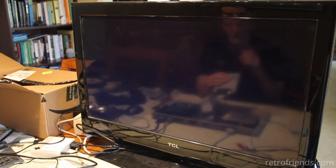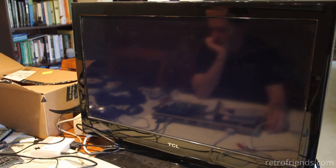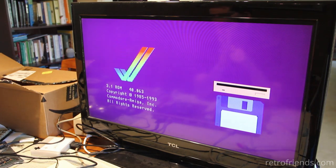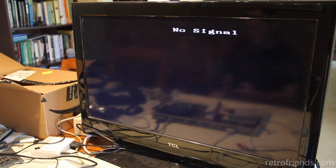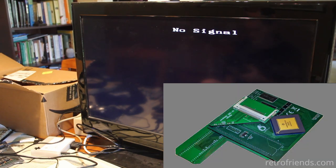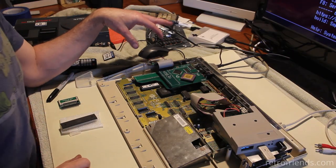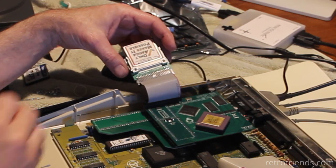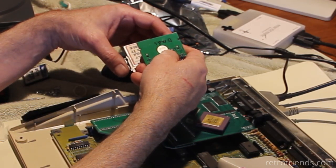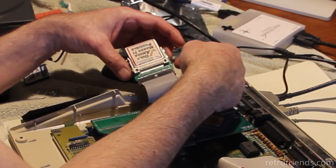I don't really have anything on this disc that's going to help me. A Workbench 3.1 might be helpful. This thing should just boot — I don't know what's going on. I went on the internet to try to figure out if I had the orientation correct, and nobody seems to be using this compact flash card with the ribbon cable. There's some kind of right-angle one without the ribbon cable. I think this compact flash adapter was reversed — it needs to go this way.